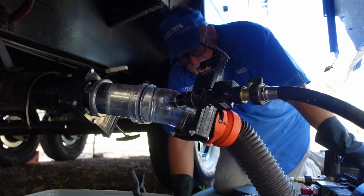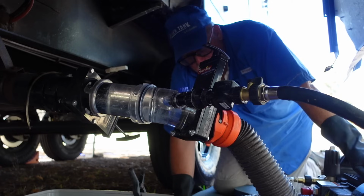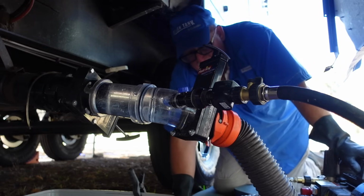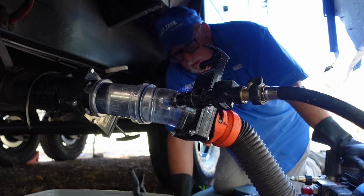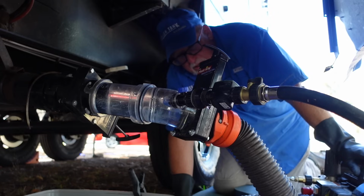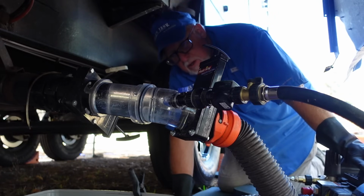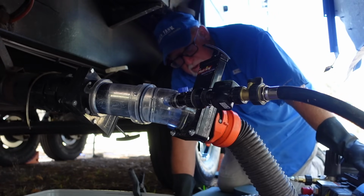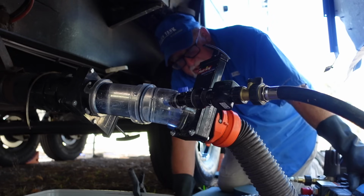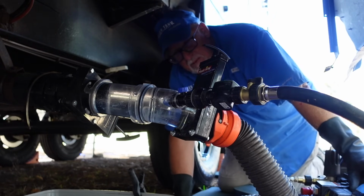Typical cleaning is either 2 or 3 tanks included at a set price. If there's a 4th or even a 5th one, we might charge a little upcharge for those, usually $25 a tank. And then if the RVer has a conventional water heater, so not an on-demand type, but a conventional electric or gas electric, then we also do a complimentary cleaning of that as part of our service. And then we obviously teach you how to clean the water heater as well. We'll get to that when we're done here after that tank behind us.